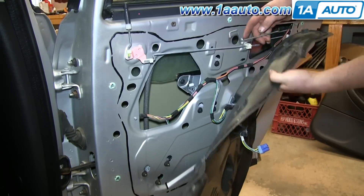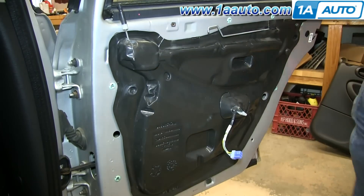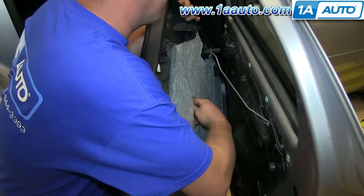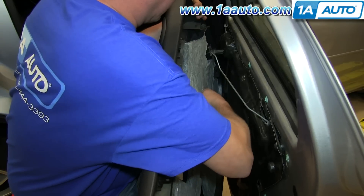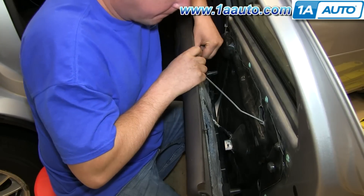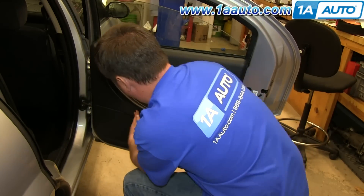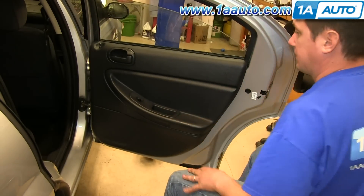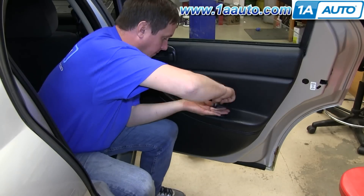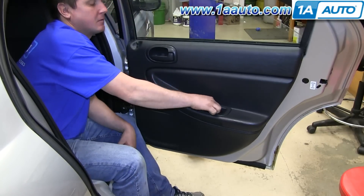Now you want to replace your water shield — just make sure you pull the harness through the door handle cable and the door lock knob, then push it into place on the adhesive. To reinstall your door panel, push that harness back into place, then take your door handle rod and put the clip back onto it. Wind your door panel up over the lock and get the clips in around the edges. We're going to fast forward as Don replaces those four Phillips screws and closes the two trap doors. And you're all set.